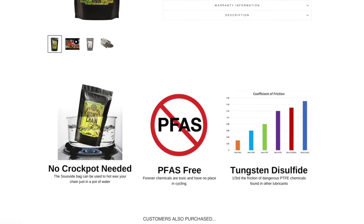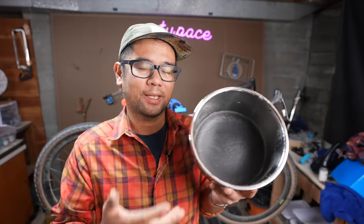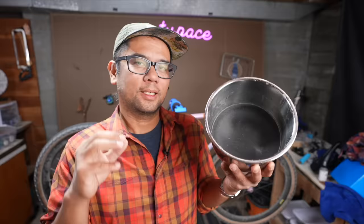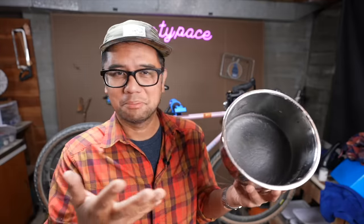The wax comes with a specific additive. In the case of Silca, it's tungsten disulfide in a very fine granular size. I know it's a thing for people to mix up their own chain wax using PTFE, but I didn't feel like going all Breaking Bad just to wax a chain, so I bought the Silca stuff because it already has the additive. The tungsten disulfide is very tenacious — it attaches itself to metals and works its way into all the nooks and crannies of your chain, and that is what acts as the friction-decreasing substance.